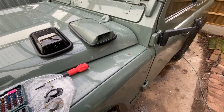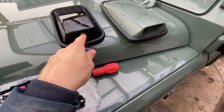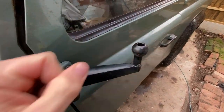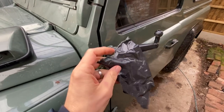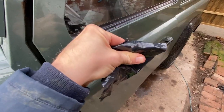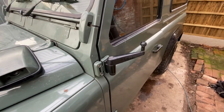After speaking to the guys over at Alive Tuning, one option would be to create some friction by making a few little scores inside the socket or on the ball itself with an angle grinder. But first I've got another idea — it looks a bit stupid, but basically this is a piece of plastic bag that stretches a little and forms a grip. I'm going to try stretching it over the ball, then put the clamping piece on, and I reckon having a bit of sticky plastic on there might make a difference without having to damage anything.